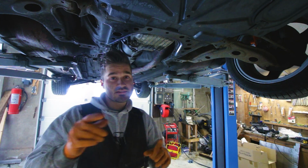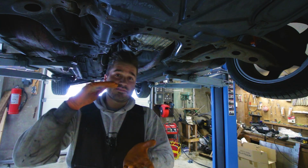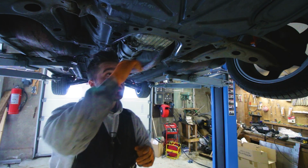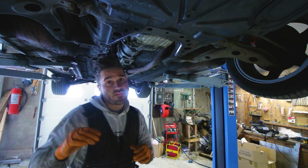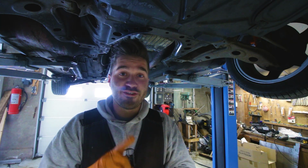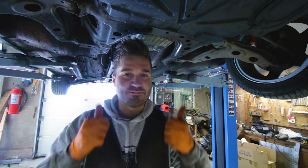So I found out that on the 1.8 downpipe that it's a bit lower. So that means that it's touching the panels and that can cause a fire. So I removed one of the trays underneath and now it isn't touching anything. There are no leaks, and what's great about it, first startup, it started immediately. That normally doesn't happen, but this time it did.